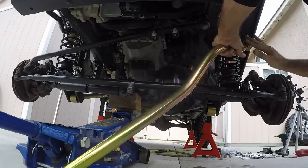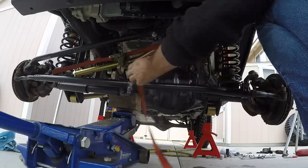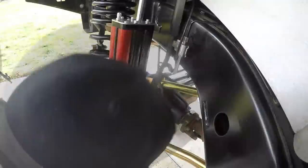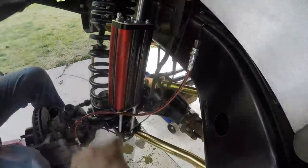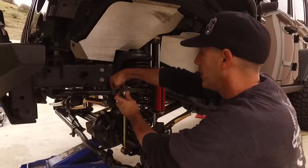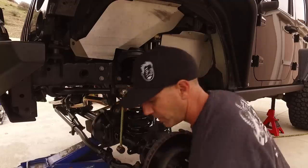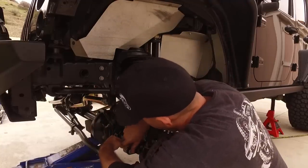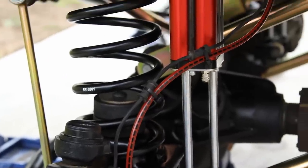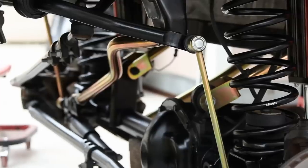Use a dab of the supplied lube on each end of the front track bar and install it, making sure to get the front axle centered on your Jeep. I used a ratchet strap as a second man to help here. Brake line replacement time — remove the stock flex lines at all four corners and replace them with the longer ones from the MetalCloak kit. On the front, relocate the bracket back one inch — mark, drill, touch-up paint, and install the new line. Put the sway bar extensions on using the ball joint at the top and stock hardware at the bottom. The final touch for the front is to zip tie your wheel sensor wire to the new front brake line. End of day one — the skies opened up and rained like crazy.